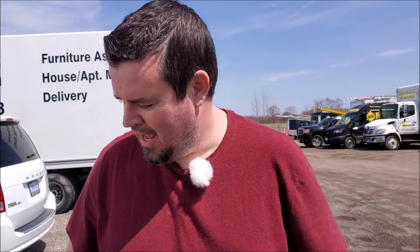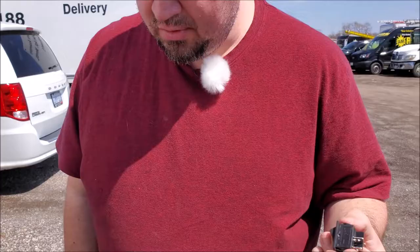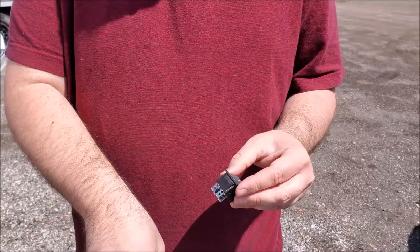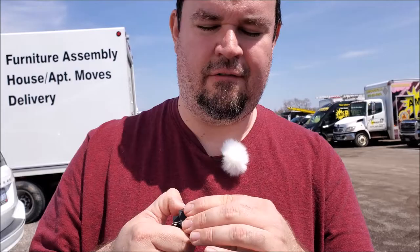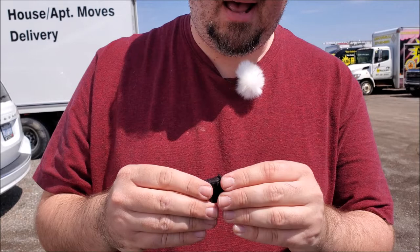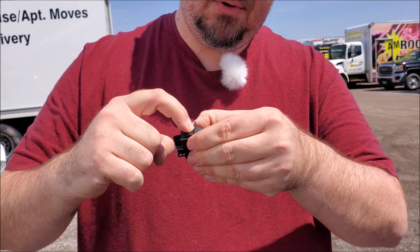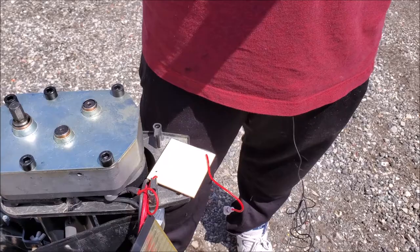As I suspected, this job was going to be a bit of a challenge. What we had to do: this is the switch that powers the LED lights — you can see the circuit board with the LED lights on the front, with a negative and a positive connection. We had to disconnect that and pop that switch out to get access to the defective switch. It has two little tabs you squeeze to push the switch out, and it's a pain to do because they're very stiff. What I ended up doing was pushing the bottom with my thumb, pivoting the bottom out, then reaching up and pushing hard with my forefinger while pulling from the outside. Just be gentle — you don't want to rip off any blade connections.